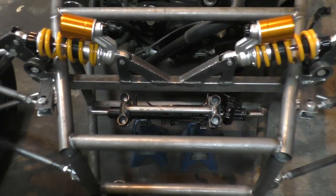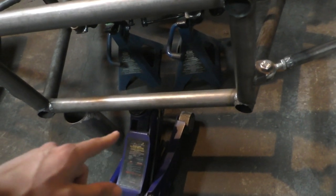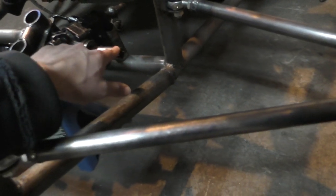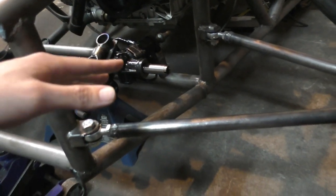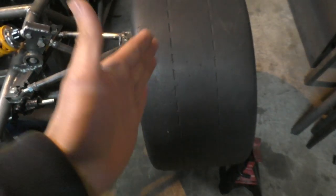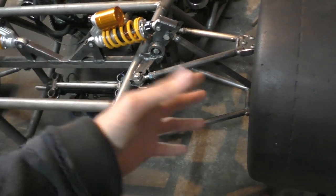I've put the steering rack in its proper place, holding it with axle stands and lifting and lowering the car with a hydraulic jack to get the position right. The steering rack has to be in a really specific place because the ball joints for the tie rod ends have to line up with the ball joints for the rest of the suspension in a certain way to make sure you don't have any bump steer. Bump steer is basically when your suspension travels up and down and if all your ball joints are not aligned properly, your tire will also change toe angle as the suspension moves.